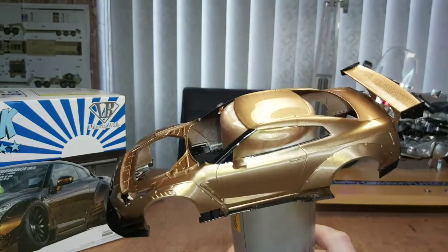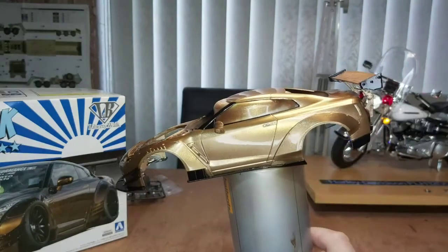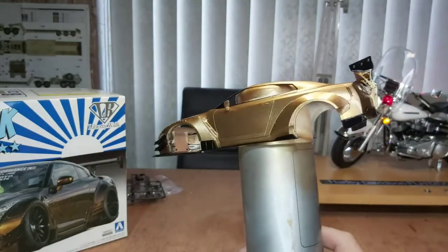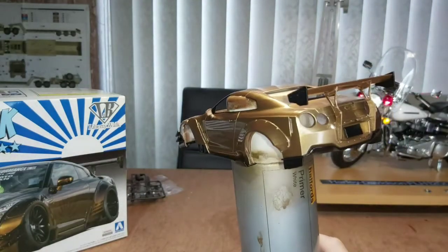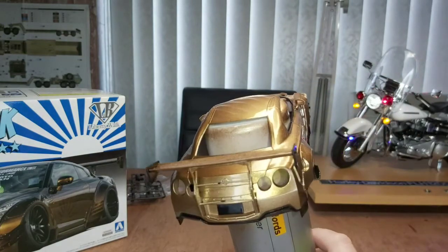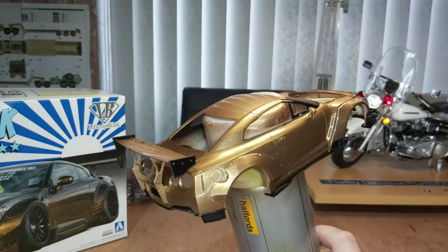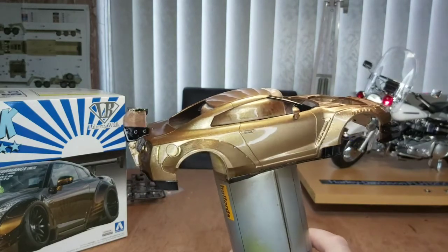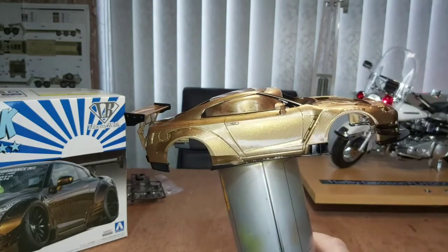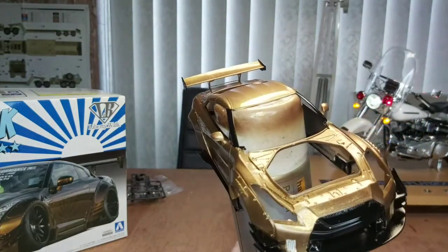Other than that, I'm just not too happy with the back spoiler. It's got two coats — I done the first coat, it wasn't the best, I flattened it down with a thousand grit, dried it all off, then hit it again. And it's come out dead on except that spoiler, and a wee touch just above the front bumper.